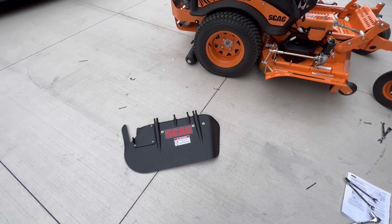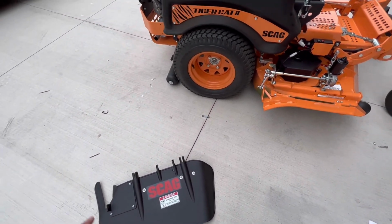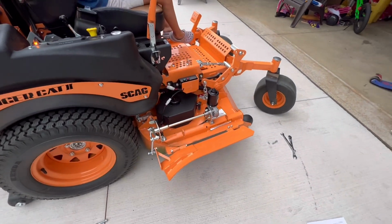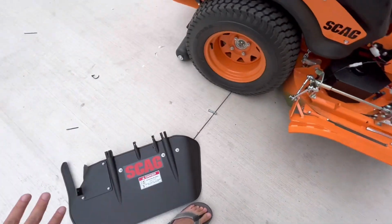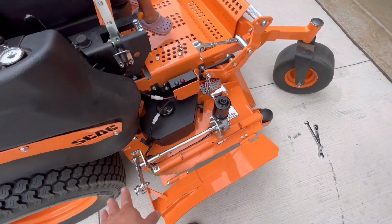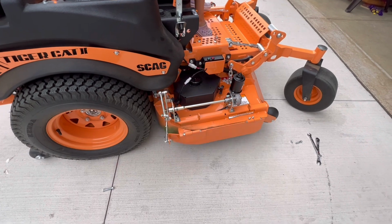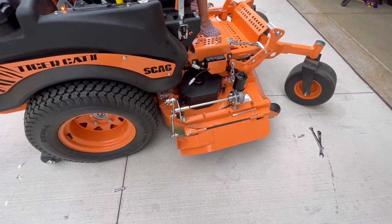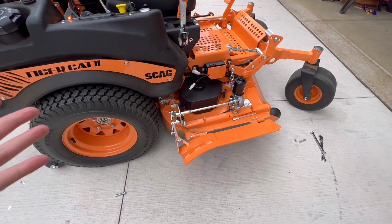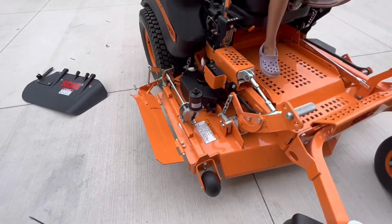Many of you are curious to see whether or not we need this flap in order to operate that properly, because I know for the manual OCDC, many of you have to retrofit a spring to keep it open or closed whenever you want it. So for curiosity, I took that off, but because it's controlled by the motor, the mechanism there should be able to hold it up or close. So try it. See? All right, open, close, open, stop. Just leave it. Okay, now open and leave it. Press. See? So it can remain open without the flap. All right, just got the answer there.